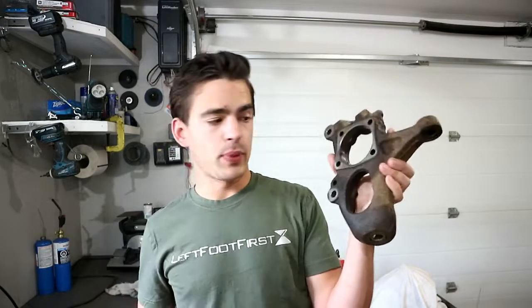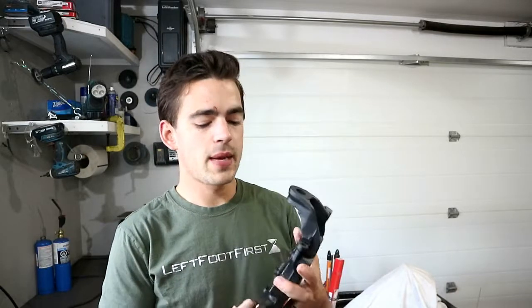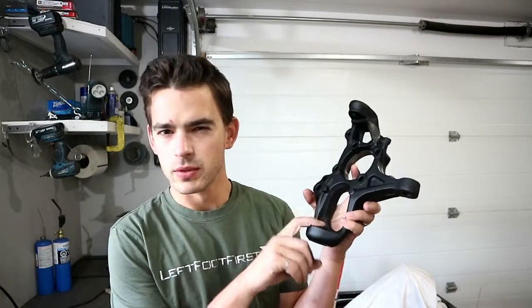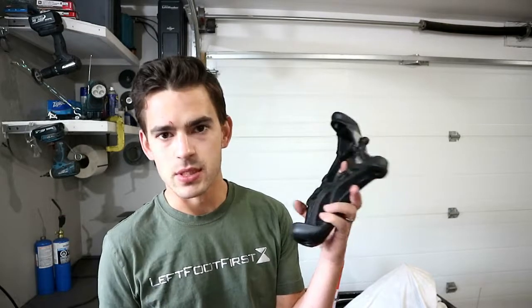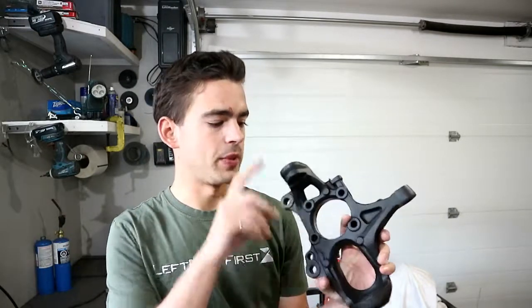And we're back in the shed. Full disclosure, it's been a couple of days, but we got the wheel bearings pressed out of our uprights. The biggest issue was these are filthy and I don't want to work with them. So I took a couple of days off camera — it was really boring work — and wire brushed off all the old paint, crud, and rust, then gave it a quick coat of paint. Now it's easier to work with. The next step is going to be finding ball joints for the top and bottom. The top I'm probably going to use a tie rod end off of like a one-ton truck. The bottom I prefer to use a regular ball joint, but if I have to, I can use a tie rod end considering the weight of the car — it probably shouldn't be an issue. I've got to measure up the tapers and do a little hunting, but that's all boring off-camera work.